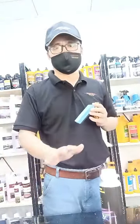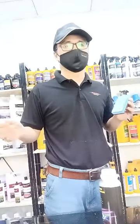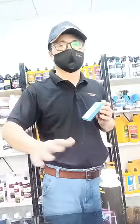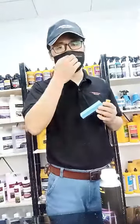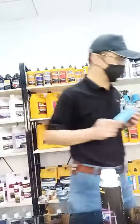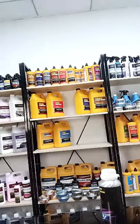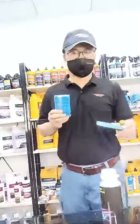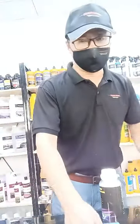First, to remove the sand, and then remove the ash and the bird droppings, and also the juice from trees and other dirt. Sometimes people use polishing compound to remove it, but our idea is not to use polishing. You can use clay bar to wash the paint. I'll show the clay bar. Use the clay bar with water to remove the dirt on the painting.